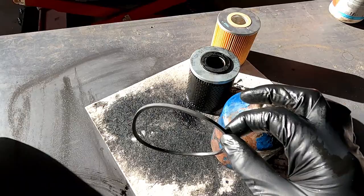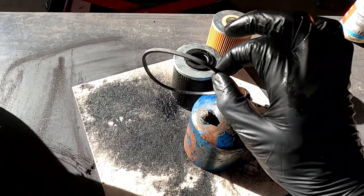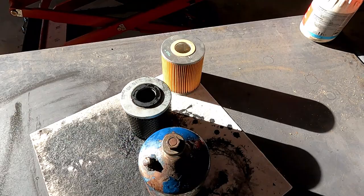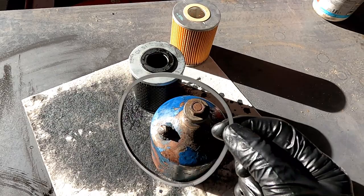And what's even more important is you don't forget to take the old one off of the housing that this screws into. Otherwise you're going to have two rubber seals and it won't seal. So you'll start your engine up and oil will piss out everywhere basically. So I'm now going to go and remove that old seal and put this one in place. Also, good practice is that you smear new engine oil on the new rubber seal,